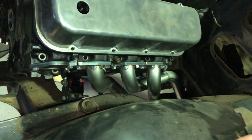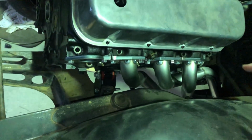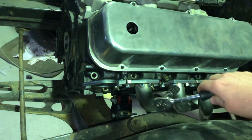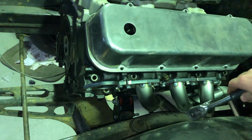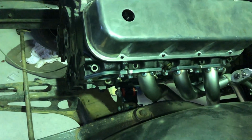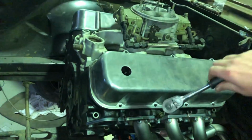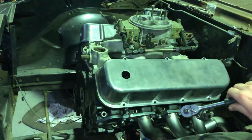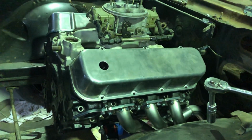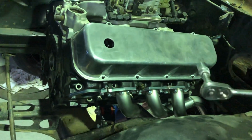Also on this video, I'm going to go through a bit of tuning stuff with the fuel tuning. So that's why this is quite important. I've got the socket up here. This car's not going to have EGTs. I've got an old air fuel data logger which will log the wideband, but no EGT. So with nitrous particularly, the way we're going to make sure it's safe and tune it and hopefully have as much reliable success as what I've had with the Ute, I'm going to be checking plugs all the time. Now, that can be a nightmare with a big block.